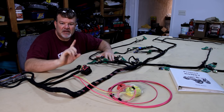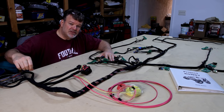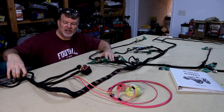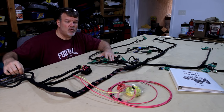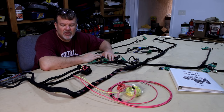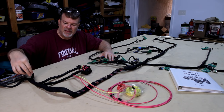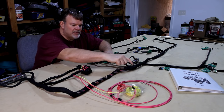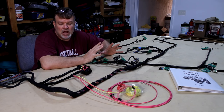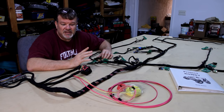So that kind of wraps up the harness - it's all complete and everything is buttoned up. I've got two more things I need to do: one is to fill the backside of the PCM connectors where I de-pinned those wires, using hot glue or silicone - something reversible in case I want to run more wires later. The other thing is I've ordered about three and a half feet of one and a quarter inch loom to run from here all the way up to about right here. My intention was to end the video here but I took a couple weeks off for personal things.